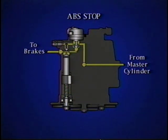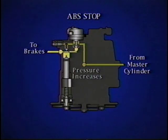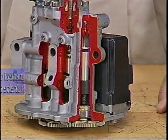Then, the motor of the affected channel is operated to move a piston down just enough to seat the check valve. With the circuit isolated, piston position now determines hydraulic pressure. As the piston is pushed up the bore, brake pressure increases. As hydraulic pressure pushes the piston down, brake pressure decreases. To hold brake pressure, the motor, gear set, spindle, ball screw nut, and piston must be stopped.